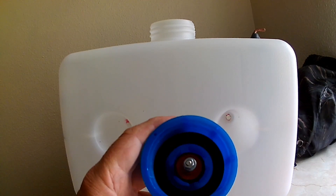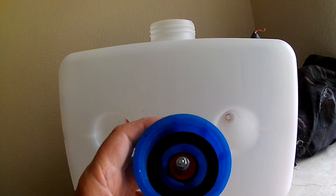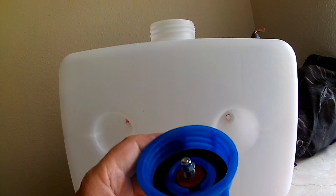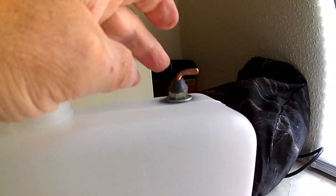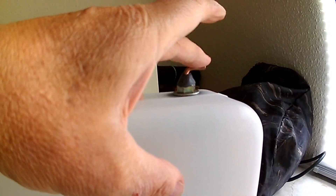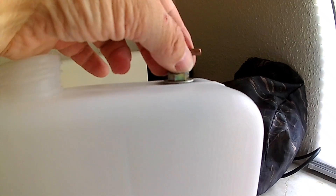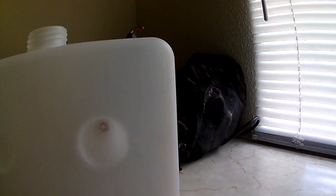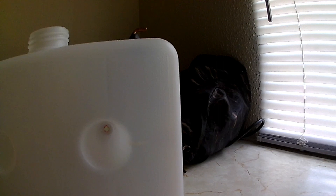It's a very simple, silly problem with this cap. If this doesn't work I'll basically buy a new tank because you can't buy the cap separately. In terms of the rotting seal, I've put some gasket cement down the takeoff pipe and some JB Weld around it, since the original sealant seemed to dissolve in paraffin. Thanks for watching — please subscribe and like. Comments welcome, whether positive or negative.